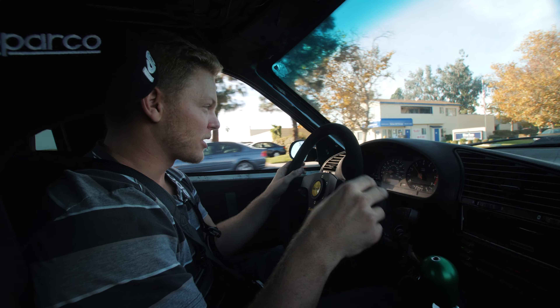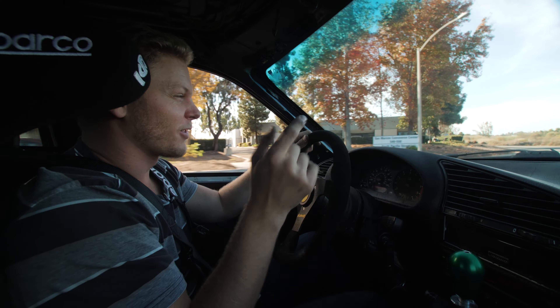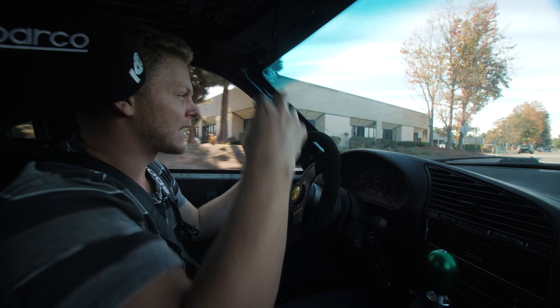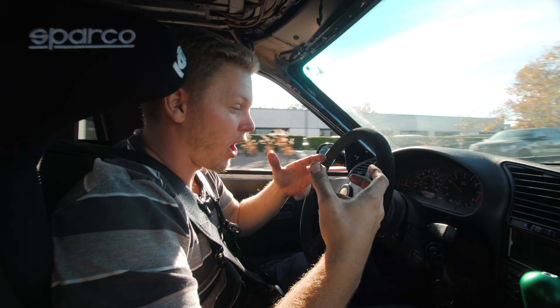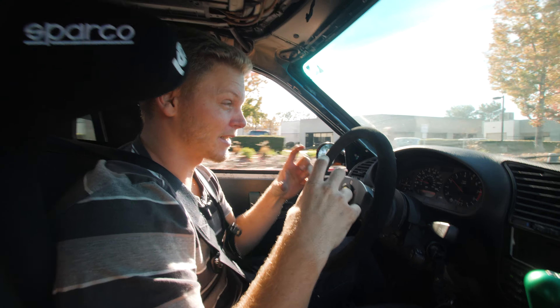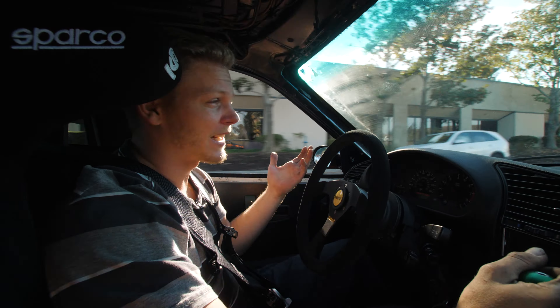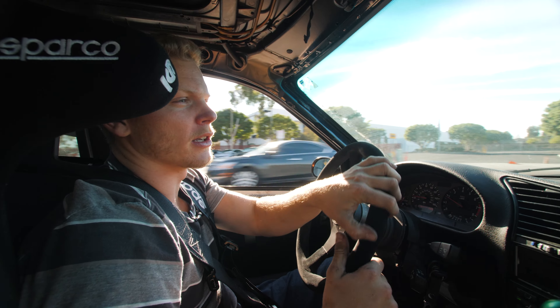Got that all wrapped up. Basically took those shipping spacers off so I can put the top hat on the KWs. The only issue I might run into is if I can't slip the new spring over the coilover — over the shock — and actually thread it. If I can't, I'll have to come back so we can compress the spring a little bit and get that thread on. Otherwise if I can, I'll just use an impact gun, tighten it up and we'll be good to go.